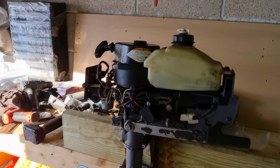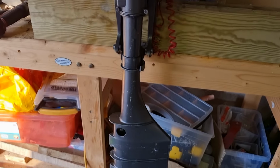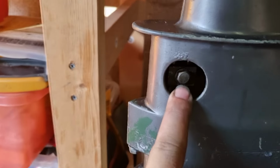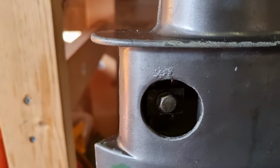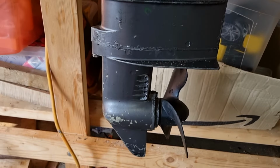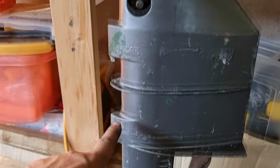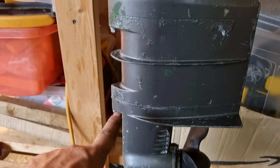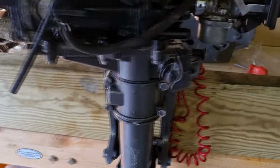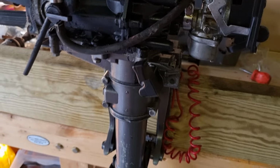I've got the impeller put back together, new ones in there, and I put the shaft back together. Took about 2 hours, was an absolute pig. The worst of it was getting this back on again, getting those rods connected. That kept falling out, absolute nightmare. But also keeping it in gear as well. Bit of a funny thing going on down there. If you don't keep this shaft properly in the right place, you can't get the gear and you can't get neutral again. We end up back to square one. However, I finally, after 2 hours of fighting, it's all back and it's all working as it should.